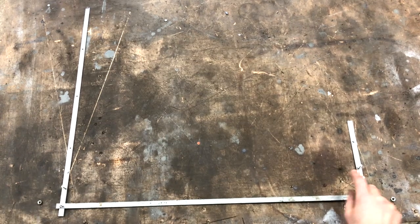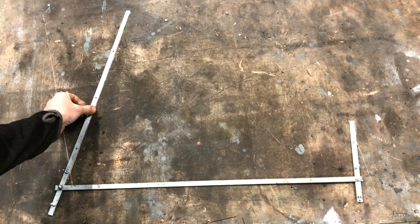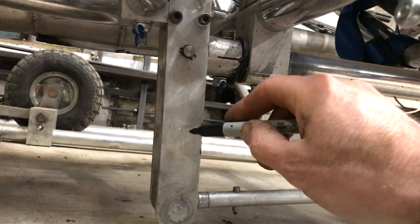If I move the connecting bar upwards by 45mm on both sides, the ratio has now changed. But if I move the connecting bar up using the same ratio to the pivots on both sides, then the overall ratio remains the same. Perhaps obvious, but I like to check I've got things right before cutting material. I can now modify the levers.